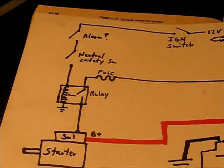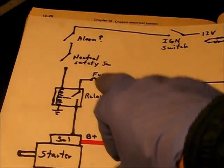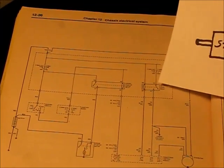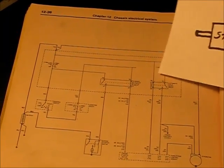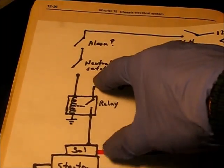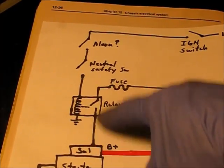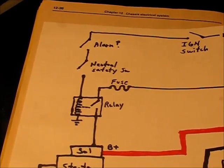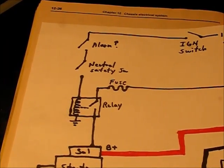The standard things first — the easy ones to check. You want to check the fuses. There are a couple of them in the particular car I'm looking at — I have a Dodge Caravan here. There's a large 40-amp fuse in the circuit for the relay power contact. You want to make sure that fuse is good, checked with power applied to it.